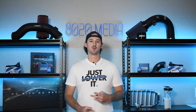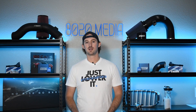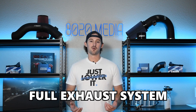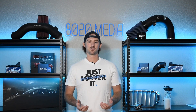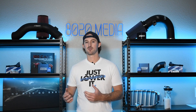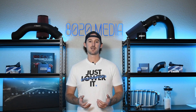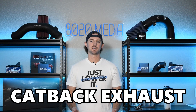The second best modification for the 4.3 Vortec is going to be the exhaust system. The exhaust system is actually quite restrictive on the 4.3, so by upgrading it we can see some pretty good power gains. The best route is going to be to upgrade the full exhaust system. These trucks do have catalytic converters on them, so you have a couple of different routes. If you want to keep your vehicle emissions legal, the best route is going to be short tube headers, a high-flow catalytic converter, and then a cat-back portion of the exhaust system.